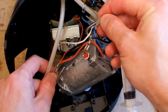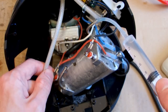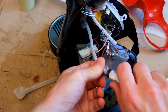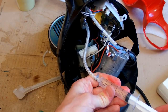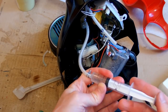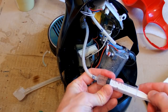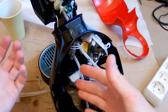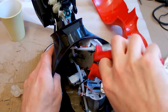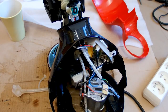So where is it stuck? Let's test it using a syringe connected to the heater - this one seems to be okay, not clogged. Now testing the pump by connecting the syringe to the output - it works but doesn't go the other way, so there is a one-way valve in it. The pump is okay. So if the heater is not blocked and the pump is not blocked, what is blocked? Is it the nozzle in the top?